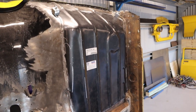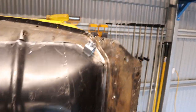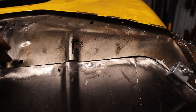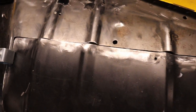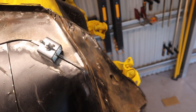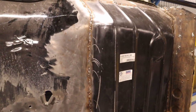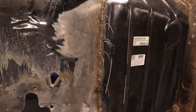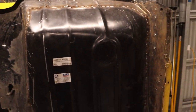A lot of cutting and trial and error later, I've finally got this piece sitting in there not too bad. There are a few little gaps — some bigger gaps up here where I think I cut this piece a bit too high — but I should be able to fill that with weld. The ribs don't really line up that well but it's probably the best I'm going to get it. It's not going to be perfect, but the rest of it lines up not too bad. I'll start tacking it in — she's all welded in, the welds aren't pretty but once I grind it back it should be all good.